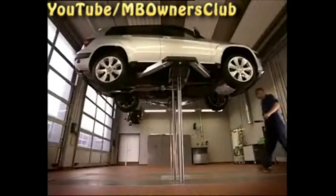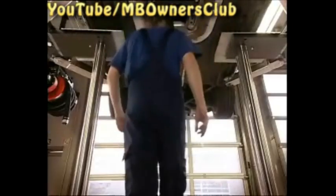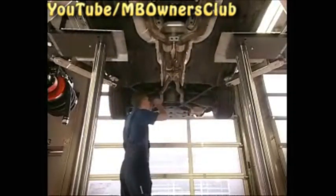In this vehicle, the breather in the rear axle center assembly is defective. It must be exchanged. The breather is directly on the rear axle center assembly. Here you already see the problem: humidity at the breather.